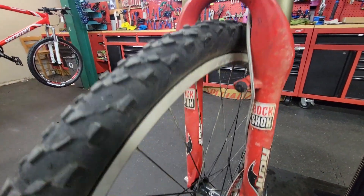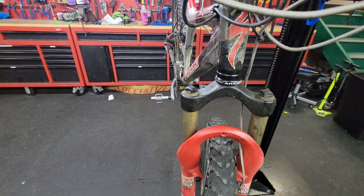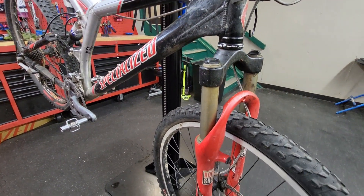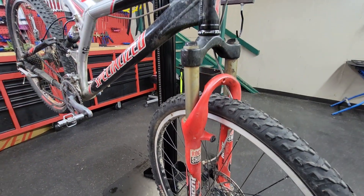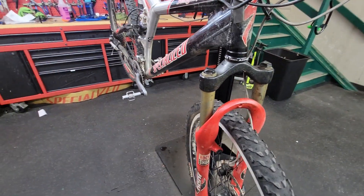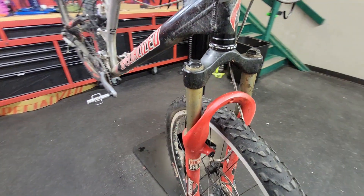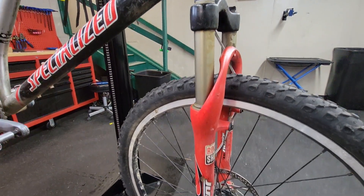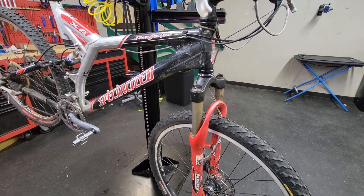The bigger concern for me is going to be the suspension. Here we have an older RockShox Judy. Although this was a nice fork in its day, it's got age on it and forks don't always age well. A lot of people, even ones that are pretty handy with bikes, don't service their own forks. And the ones that do have to be able to find parts. I'm sure you could probably find seals for this, but as time goes on they're going to get harder and harder to find. So it's not going to be super future-proof to get seals for this fork, even if you can rebuild it. A lot of services and shops that do rebuild forks probably won't do anything of this age just because of how old it is and how hard it is to get parts.